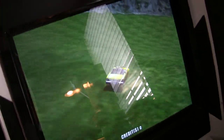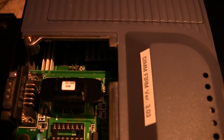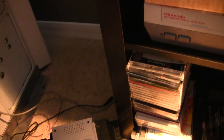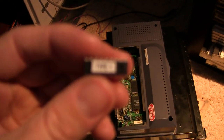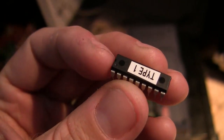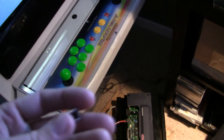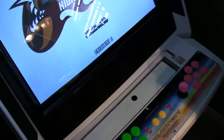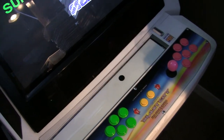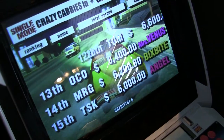If I were to coin up this game and try to play it, I could probably get as far as the selection screen and it would crash, because I don't have a network key installed. You see that key? That's a House of the Dead 3 key. If I had a Crazy Taxi key, neither of those would work here — you need a special NetBoot key that someone has to burn for you. That key would be inserted with the notch facing out towards the side of the network cable. There are some checkpoints in the games, and it seems like all the games quit if you try to play them without a proper key. I'd use the key I have but it's not working right, so I've got to get a new network key for my Type 1.